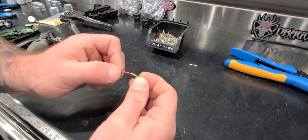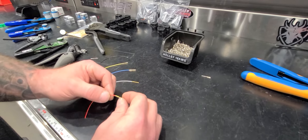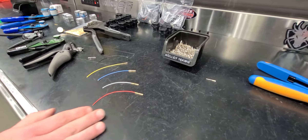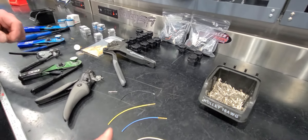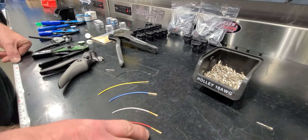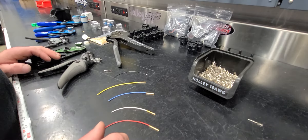Just like an Autosport or a standard DTM, DTP, or DT series connector that uses a size 12, 16, or 20 contact — these new solid barrel contacts use the same functionality as the Deutsch stuff. So if you're used to using Deutsch stuff, you just need to switch over to these because they're fantastic.